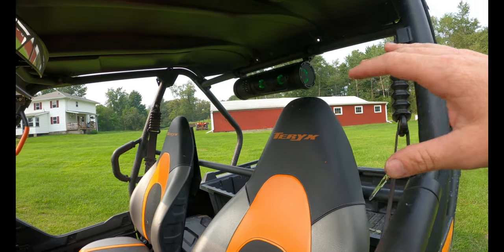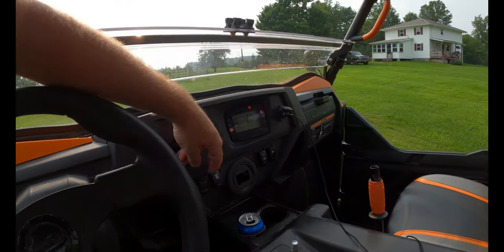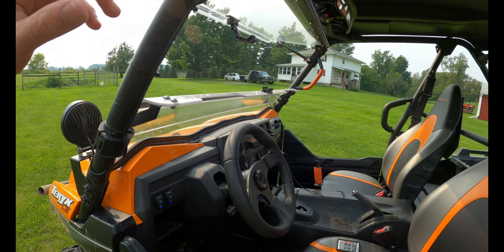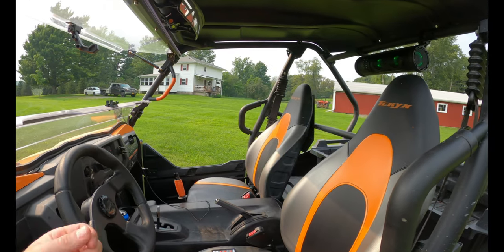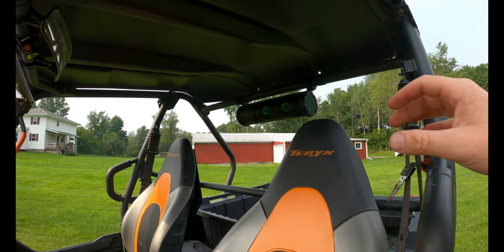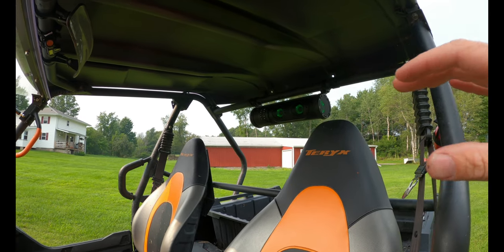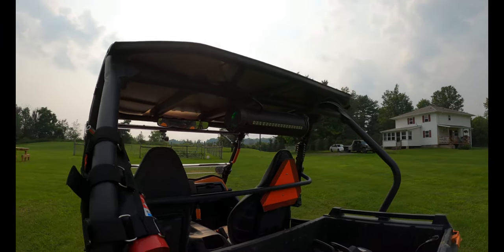The other thing I definitely do different than what I did in this video for you guys is I put this on keyed power, the switch, and that should really go on constant power. Because when you stop on the trail and you have a drink with your buddies or whatever, when you shut your machine off, the speaker shuts off right now with it. If I had that on constant power, I could keep my music running and I wouldn't have to reach back and turn that back on after I turn the key off. So that was a mistake on my part. That's something I'm gonna rectify here pretty quick.